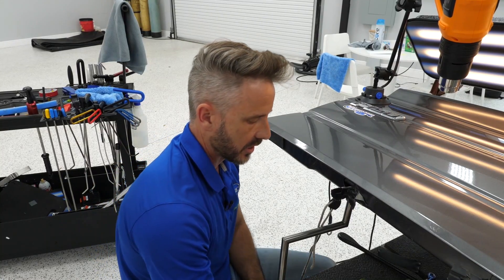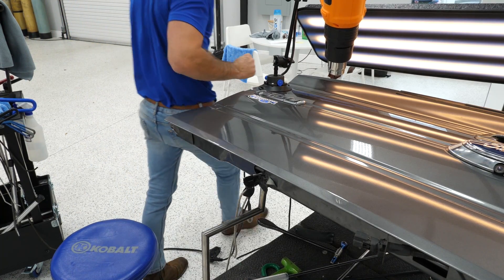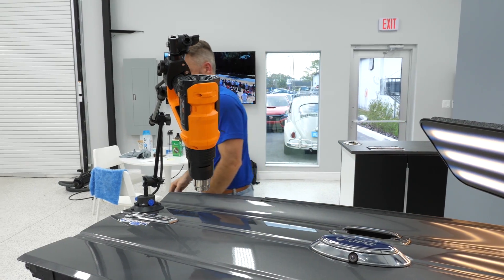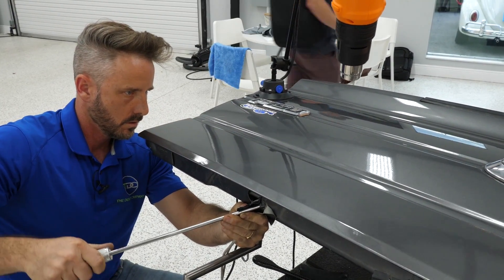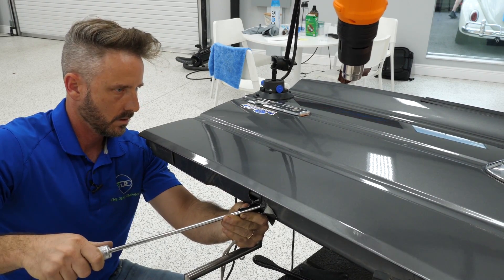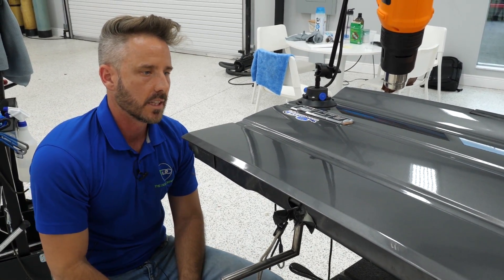Now what is important is texture. There are very little microscopic changes in orange peel down at the bottom. Prior to sanding with maybe 2500 grit to just nib them out, at the same time I've got to make sure I'm metal-depth corrected — not too high, not too low — as I'm coming up from this point. If you're not careful you'll sand out the clear coat and see it even more. Actually it'll do the exact opposite — I'm not going to hit the orange peel. I'm going to leave the little two or three push marks intentionally high, and that's going to ensure the paper is just hitting that spot.